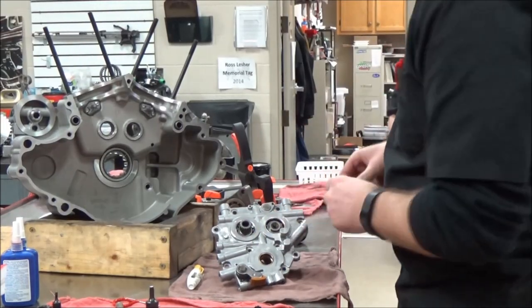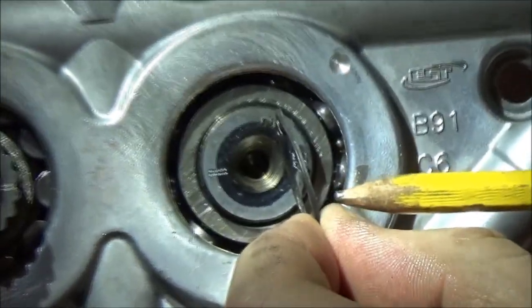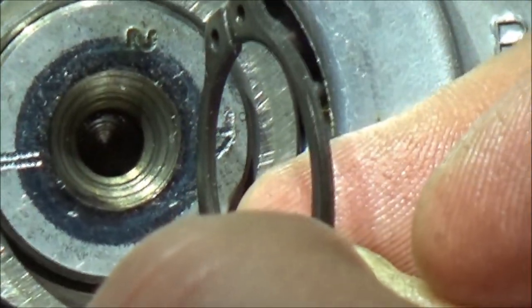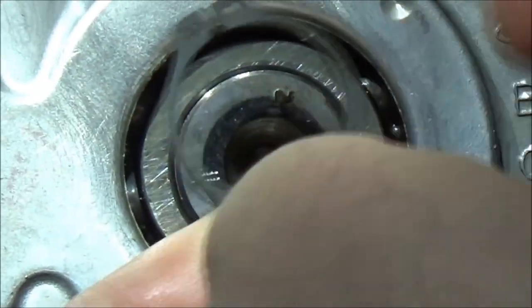One last thing here is we have a snap ring to install. Remember how we talked about snap rings and how they have a flat edge — which is this side — it's a real sharp edge right there. And this other side is rounded. Here's a great photo that shows a nice close-up of that straight square edge and the thrust load. The thrust load would actually allow that snap ring to push up and off if you don't have as much real estate against it. The service manual is specific that they want the flat side facing out because that's the thrust side — that's the side that wants to push the camshaft off.